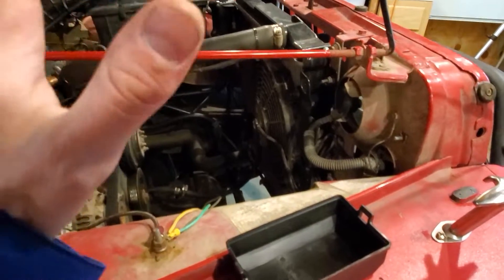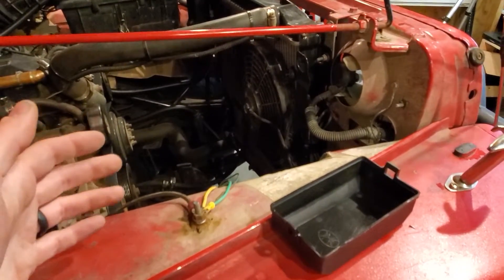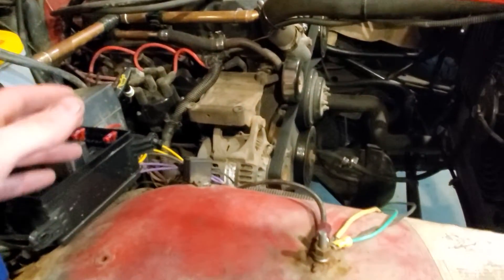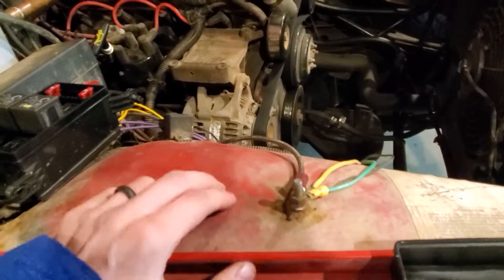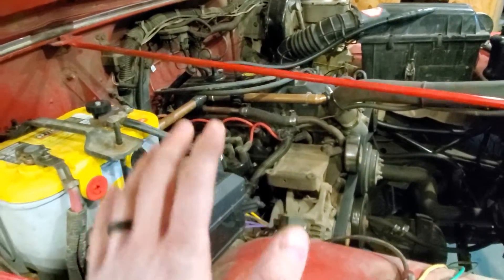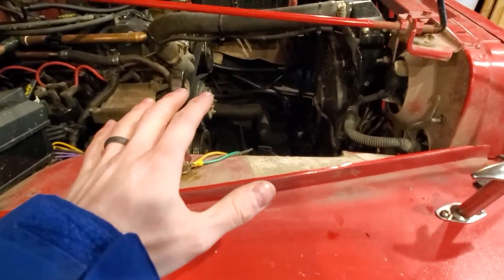It's really important to have a manual option somewhere — not for the whole system, but just something to do additional cooling. I've also been playing with the idea of having it turn on when the car turns on, which isn't a bad plan. Of course when you have power you also need ground, and this ground wire goes to a bolt welded into the body of my vehicle. I will provide a wiring diagram so you can see how this all makes sense.